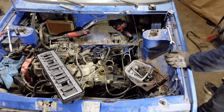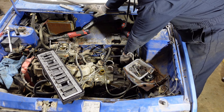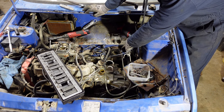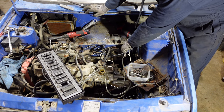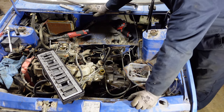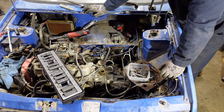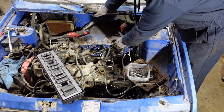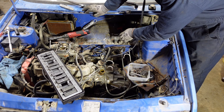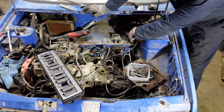Brake booster disconnected from the pedal — pretty easy actually. I'm not even sure why the spacer is here. The car has got the clutch cable, not hydraulic, so I have to add an actual master clutch cylinder next to the brake cylinder. I think I should have enough room — maybe run a Wilwood short one, just like my other Fiat Busa — and I think I should be able to squeeze them in behind the engine block.